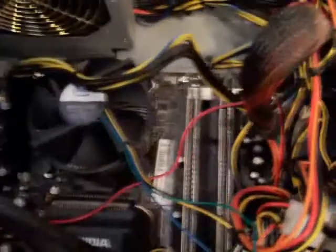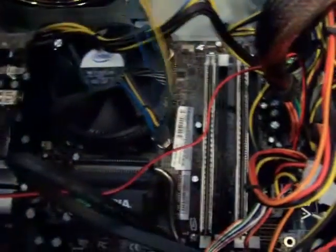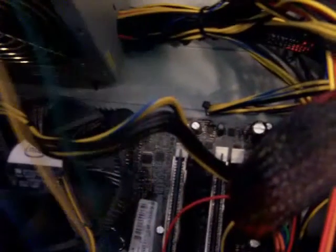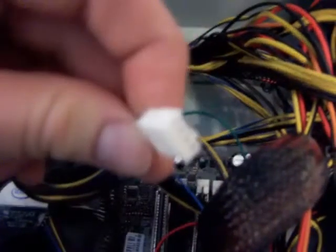Once the fan is completely installed, you need to attach the power supply wire. There's a little wire coming off the fan — the processor itself doesn't need power connected directly. Next to the fan on your motherboard, depending on your board, there should be a four-prong connector labeled something like 'CPU fan.' In my case it's right here. Line up the notch, plug it in, and that gives power to your fan. You have to have power to your CPU fan, otherwise it will fry — and that's bad, considering the processor is one of the most expensive parts in your computer.